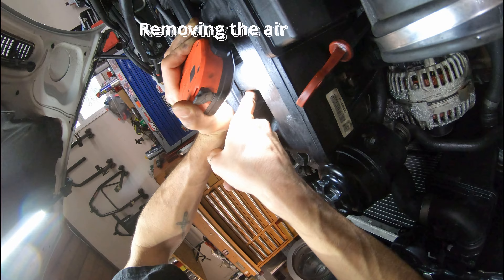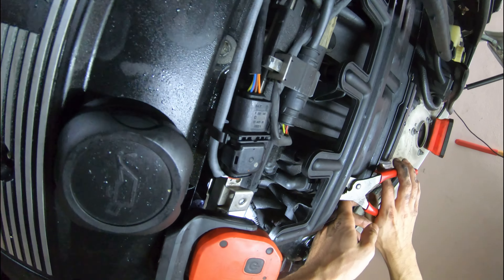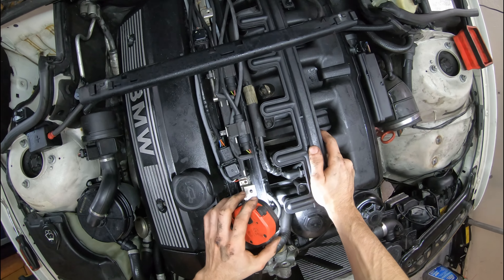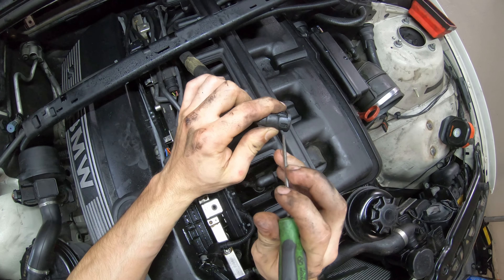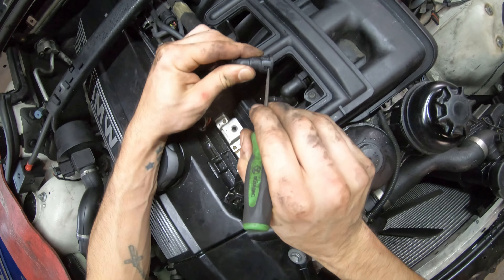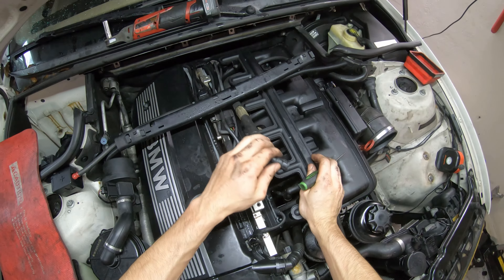See there's a hose up under here with two push tabs on the sides. You're going to want to get on those push tabs and push back on the hose to get it up off that connection. A set of needle nose should do it if you're real careful. You have another smaller hose right there that you're going to have to disconnect as well. You kind of have to push in on the hose and then get a pick up in here and lift up on this tab in the keyway because this hose has an internal locking mechanism.